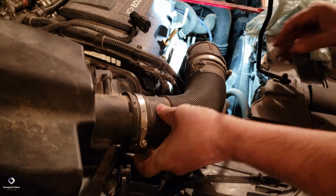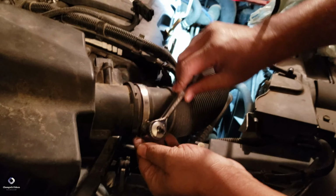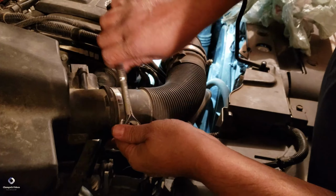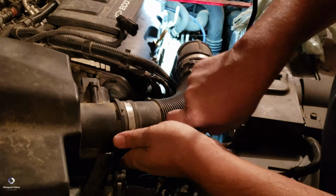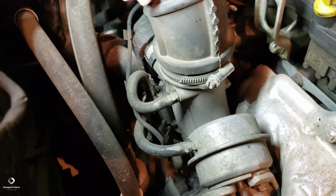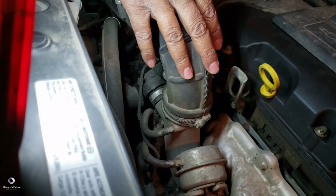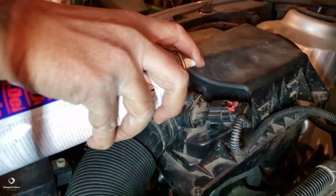So that's it. This is a 7mm screw here. Just use that and tighten this one. So now we've tightened the hose here. Make sure that it is not loose, because it can suck in air from outside. And if dust goes into this one, the turbocharger will get wrecked. And again, we connect this one. It's too dusty, so probably just clean it up a little bit.